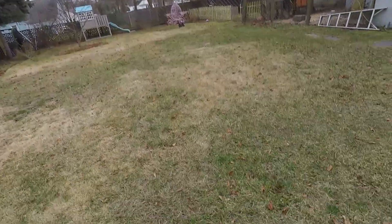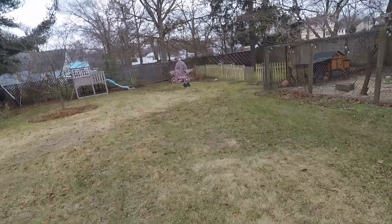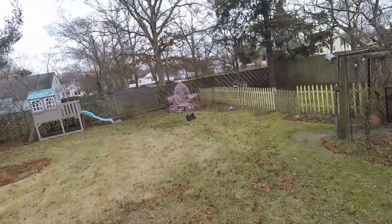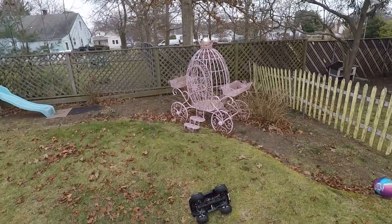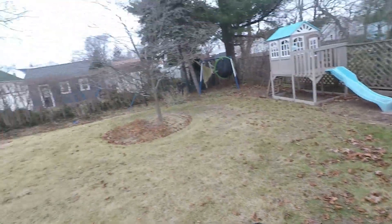This is where those damper shocks are really not doing any good — the truck leans and it's got nothing to push against. So if you're going to run 3S, I highly recommend going to an oil shock, because it's a lot more fun but just not as stable.